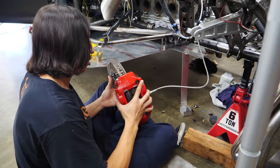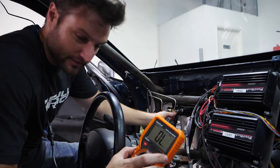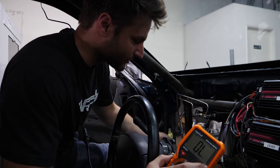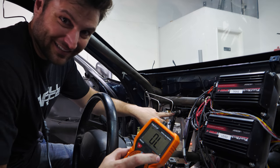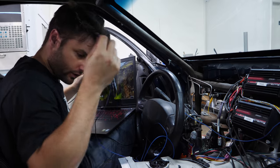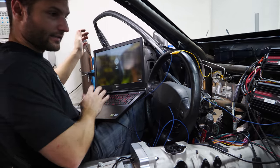So this is our very first test. I haven't even bled the system other than hooking up the front brakes. We're going to see if this is open or closed — nothing yet, sweet. The system hasn't been bled so there's tons of air in it, so it's not getting up to 20 psi quickly, but on a bled normal brake setup it would trigger instantly. This is a low-pressure switch — most are like 50 psi — just for guys looking to do something like this. We're going to wire it up and test it. This is the line from the PDM that tells the car we're hitting the brakes.